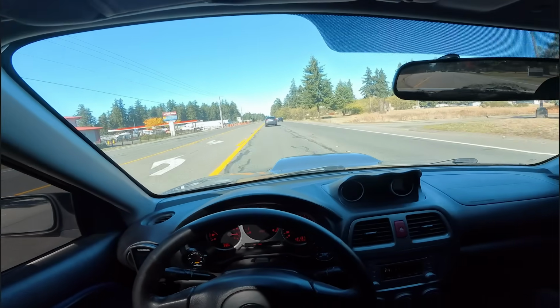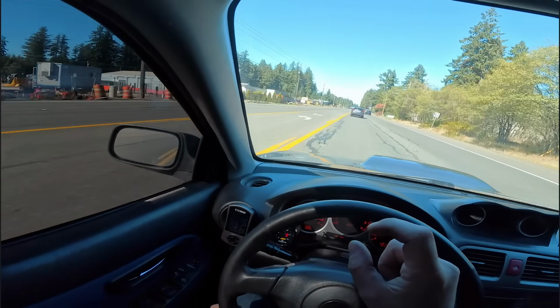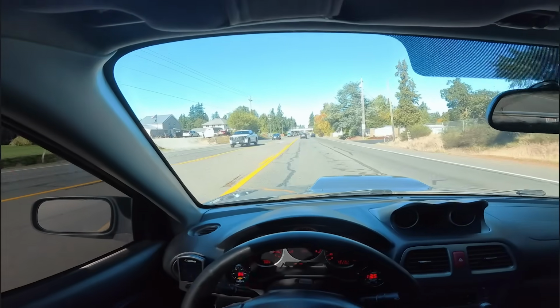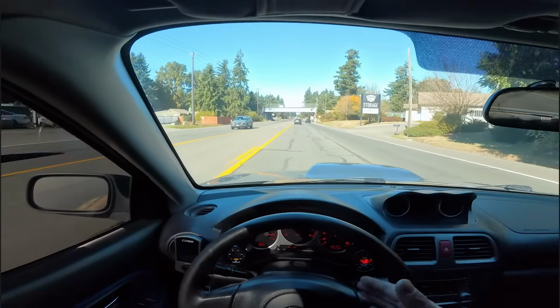The turbo sounds really good too. That DOS Performance turbo comes in quick. I want to give the car a little bit more timing down low just to aid the turbo a little bit, but outside of that, the car drives great. It drives phenomenal. Cruising and wastegate is so easy to tune on because you don't have to worry about the boost variable. The car's gonna make what the car's gonna make.